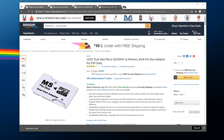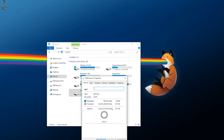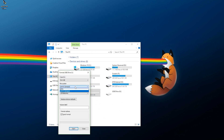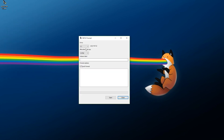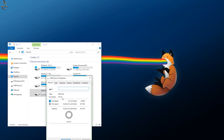Once you have everything ready to go, take your micro SD card, plug it into your computer. As you can see, mine is in drive I. Right now it's just exFAT — I cannot easily format it to FAT32 from here, so this is where GUI Format comes in. Open up GUI Format and run it as administrator. Once open, make sure you have your proper drive selected, keep the allocation unit size as default, and then do a quick format and press Start. Once that's done, right click, check the properties, and verify that your micro SD card is FAT32.